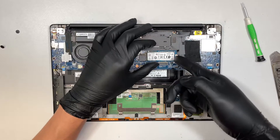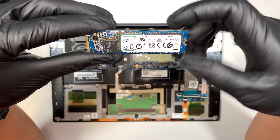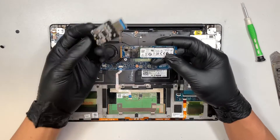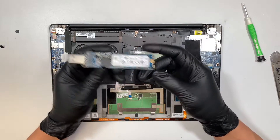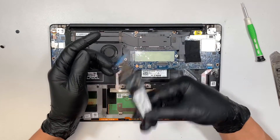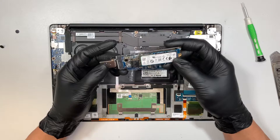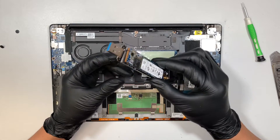This is your M.2 drive, which is your hard drive, and this hard drive here is 512 gigabytes. Now if you try to upgrade the M.2 to a larger drive, what I recommend is to get one of these USB adapters. This USB adapter allows you to pull the data out of the drive — you insert the drive here, make sure you put the screw or tape to hold it tight, then plug it into any computer and you can see your files. I also made a separate video regarding cloning the hard drive — if you feel the drive is too small and want to upgrade to one terabyte, check the link in the description below.